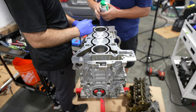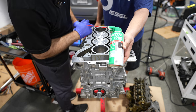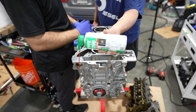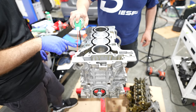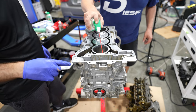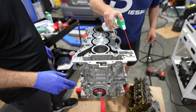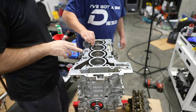So this is the best gasket remover that is on the market. It actually has a Mercedes part number. There it is. Yeah, I'll put a link in the description. This stuff's great for even removing dried up silicone, but it gets into the micro cracks. It's pretty awesome. You let it sit for 10 minutes and it does its thing in preparation for the head gasket.